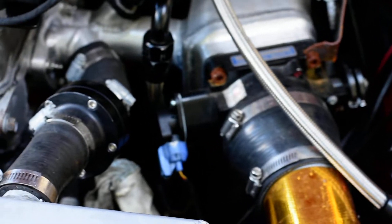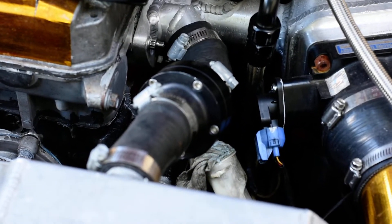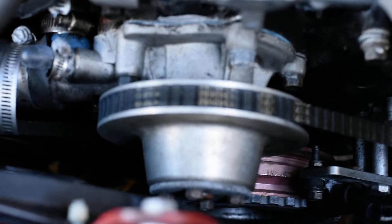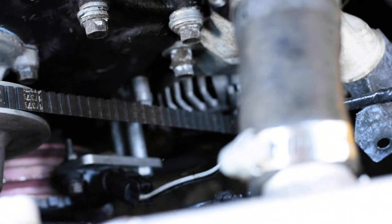Got a lot of cleaning to do — the car's in Florida and I was in New York. Three inch intercooler piping, custom thermostat housing, GM style. I was going to buy the K-Tune version but I had to wait a couple of months and I needed the car running. Four inch intercooler, upgraded transcooler, three inch intercooler piping. Now direct fire — that's the crank trigger. Aluminum pulley, crank pulley, aluminum water pump pulley. 180 amp alternator with the aluminum V-belt pulley, thanks to Quality Power.